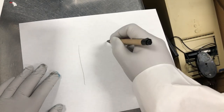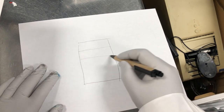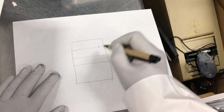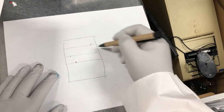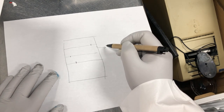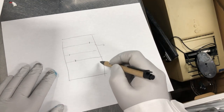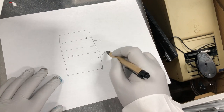And the third design is called the chamber design. The design is like this. I cut a tank into a series of chambers, and they're at different sizes. And then there's a small connection among the chambers. So for example, when your ink is high, maybe you want the ink to be harder to suck out because your ink is high, there's a pressure already. And when the ink is low, you may want to make the chamber a little bit bigger, and so it's easier to get the ink out.